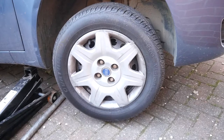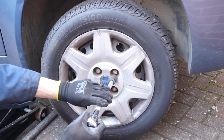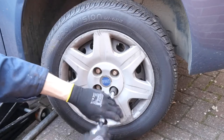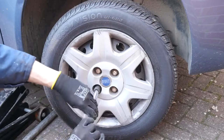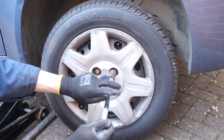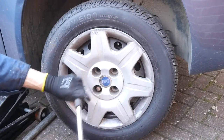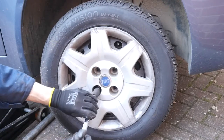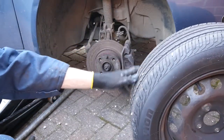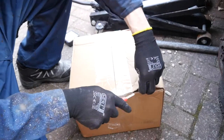This is the final position — we'll get this wheel off in a moment. Incidentally, this wheel hubcap is an interesting one because it's actually held on by the bolts, so that's kind of annoying but also kind of good — if you hit a curb it's not going to just fling off. Keep these somewhere safe when you take them off and try not to get the threads too dirty. Once the wheel's off, make sure you just shove it underneath the car unless you've got axle stands — that way if anything happens with your jack and the car falls, at least it's not going to crush you, and it'll leave enough gap that you can get the jack in afterwards.